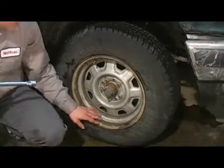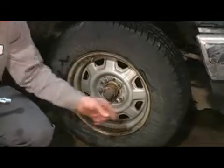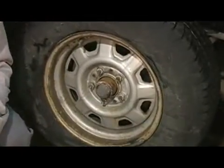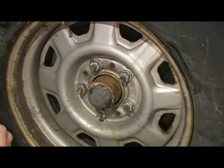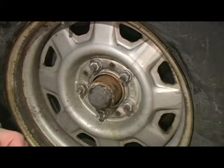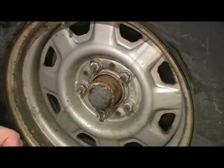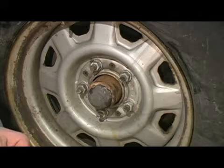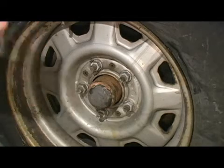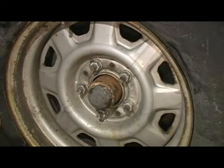This particular model is relatively stripped down and it comes with steel rims. The specification for steel rims is 80 foot pounds and they don't need to be rechecked after you tighten them down. If it happened to be an Eddie Bauer edition or a fancier version it would come with aluminum rims. The spec for those is 100 foot pounds — just about as hard as you can pull with one hand — and after 25 miles you're going to want to recheck the lug nuts.